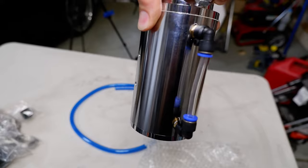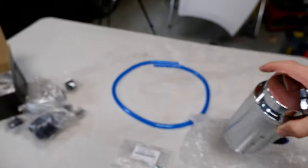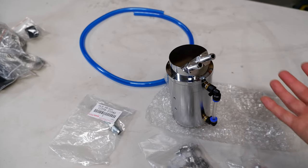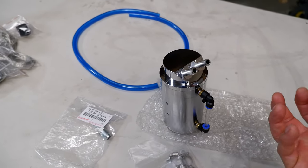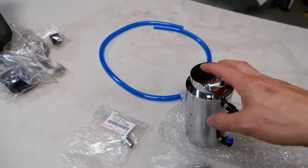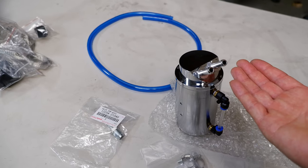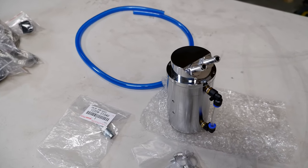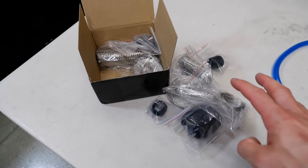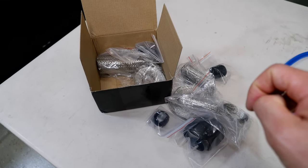This thing's got a little window to see how full it is. The bottom has a little nut so you can take it apart and clean it. I think the top comes off too. Some guys online had a hack where they opened it up and put steel wool inside to help catch more grime instead of just having oil that might come back through the PCV. I'm not going to do that - I'm probably just going to periodically monitor it. The dress up kit was like 30-something dollars, which actually cost more than the whole catch can setup.